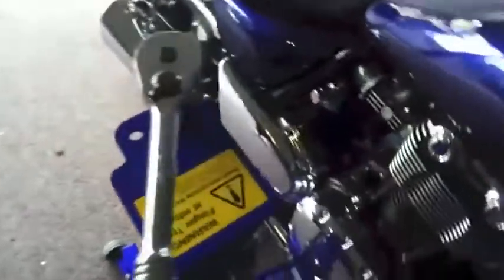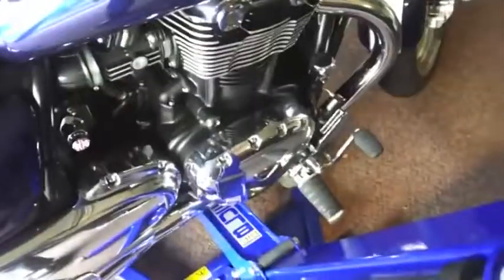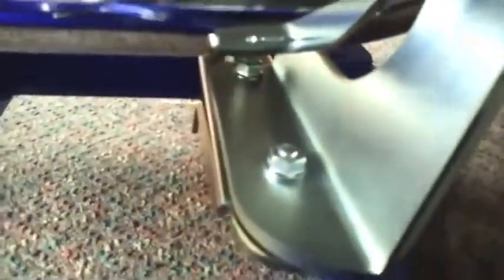Keep an eye on the bike. Watch how it slowly comes vertical and every now and again you can take a peek over the top of the bike and have a look at how things are looking on that side. Keep turning and looking until eventually you'll see that the right hand side hole is almost lined up. If you keep these bolts at the bottom here loose on this side so that there's just a little bit of free play in that bracket, you'll be able to fit the screw through quite easily.